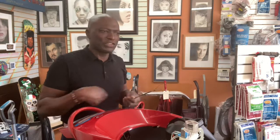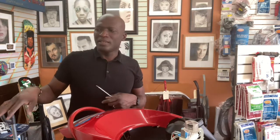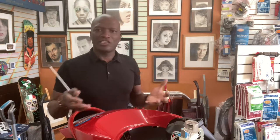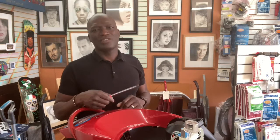So think about it. You shampoo, you put it to the side, and the heater is still hot. It's probably going to be hot for another 20 minutes or so, right? So it's just baking the stuff in there. After a while, it gets so gummy and hard. When it's time to pump, there's too much hard debris in the tubing and in the heater for it to pump. So that's why I just say, leave the heater.